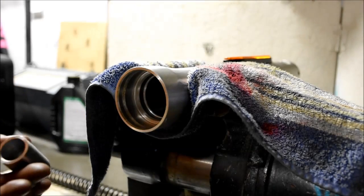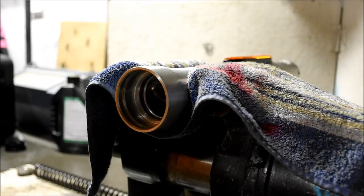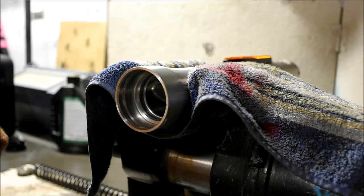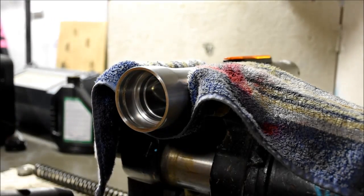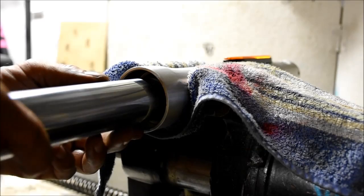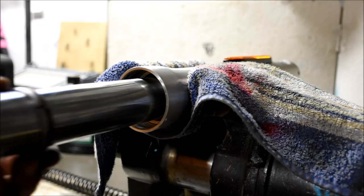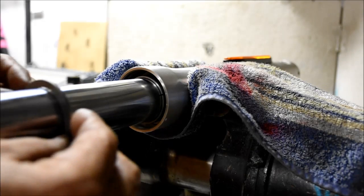The first thing we're going to do is put this aluminum sleeve in the slider. And in the fork tube, let's go ahead and put our damper in there and just let it bounce around like so. Then we'll feed this in here, making sure that we pick up that sleeve. Then we put the slider bushing on and this ring.